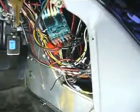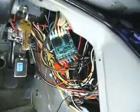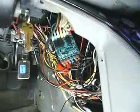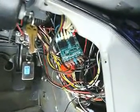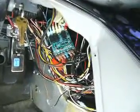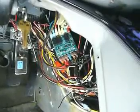This is the controller itself. It gets installed behind the switch console and it's a single board. The cable and the harnessing plugs directly into the Pantera cable harness without modifications. You remove the connector that resides over the steering column, put on quick disconnect terminals, and connect it to the board.